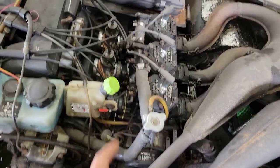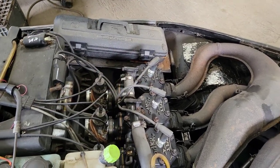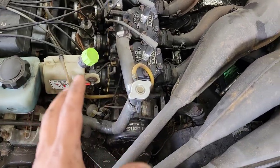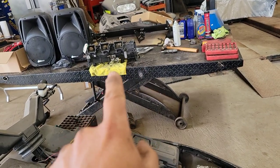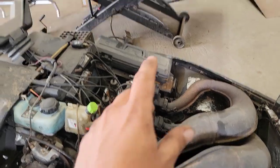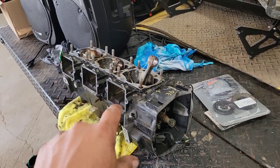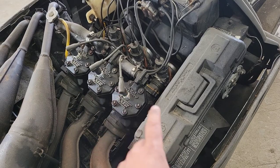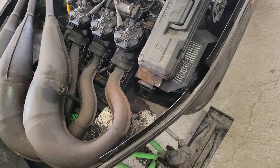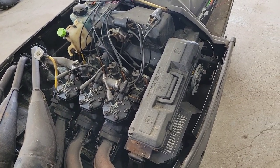So last time, we were spraying some brake clean around the clutch there when it was running, and the idle was going up and down and all that. So we know the crank seal's leaking, and they were growling and howling pretty bad. So we'll yank this sucker right out of there and get her up on the bench beside that one. We'll tear it down, get all the jugs off, and then I think I'm probably just going to end up using this whole lower end. I'm going to split it apart and put new seals and everything in this one anyway, but I've got a pretty good feeling that the inside of this one's pretty scuzzy looking from all that water and rust and God knows whatever else is in there. So we'll make some quick work of this and yank this sucker out. This should be way easier than pulling out the four strokes, so let's get at her.